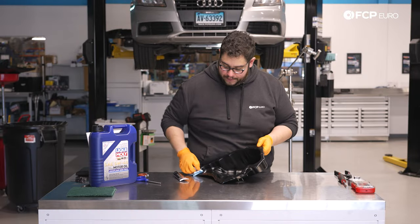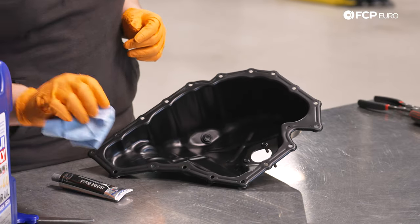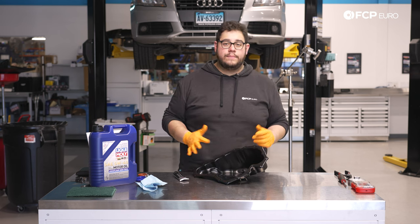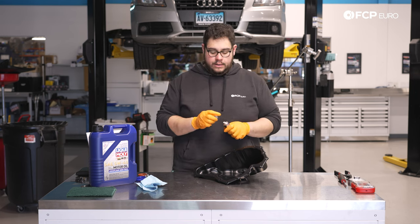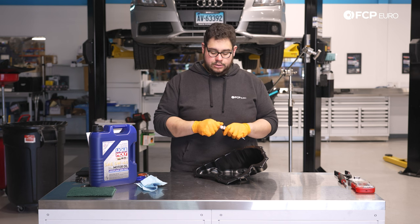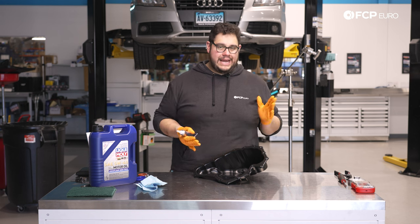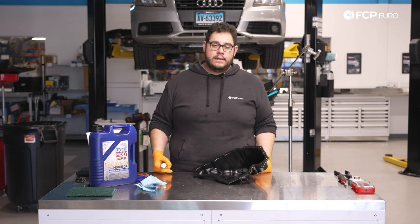We're at the workbench, cleaning up the edges of our oil pan — even though this one's a new one — with a little bit of brake clean. We did a couple of test fits onto the block so we got a little bit of oil on there. If you're using your old oil pan, be sure to use a cookie wheel or a light wire wheel around the edge to get all the old glue off — it's okay if it chews up the surface of the metal a little bit, as that'll give the sealant a better bite. Today we're going to go with the Ultra Black, which is part of our kit. Make sure you go inside of the bolt holes, not on the outside, and keep the bead nice and even — about an eighth of an inch in thickness. Once it goes back on the block it's going to smush down and flatten out a little bit.